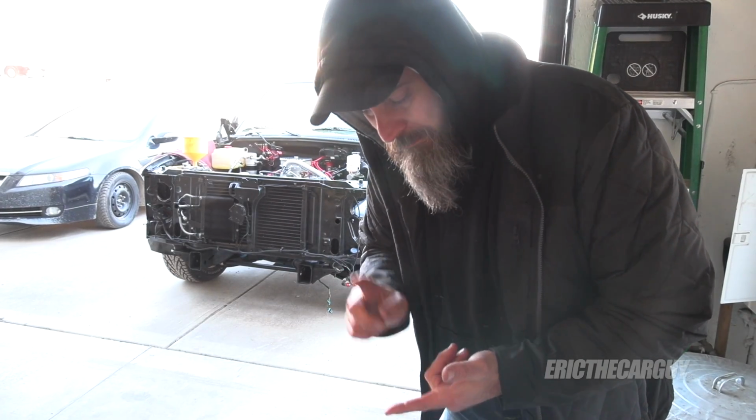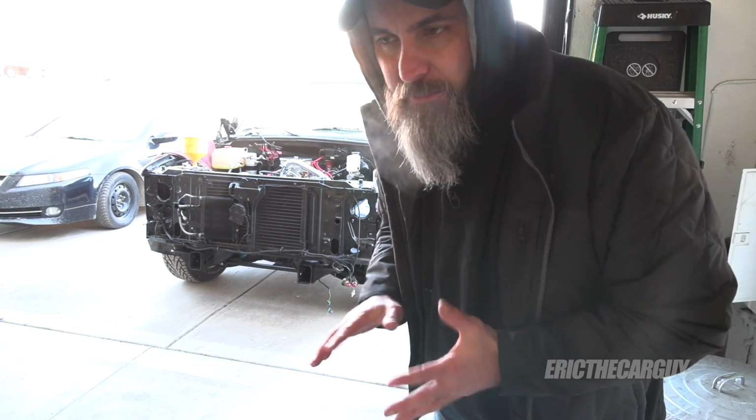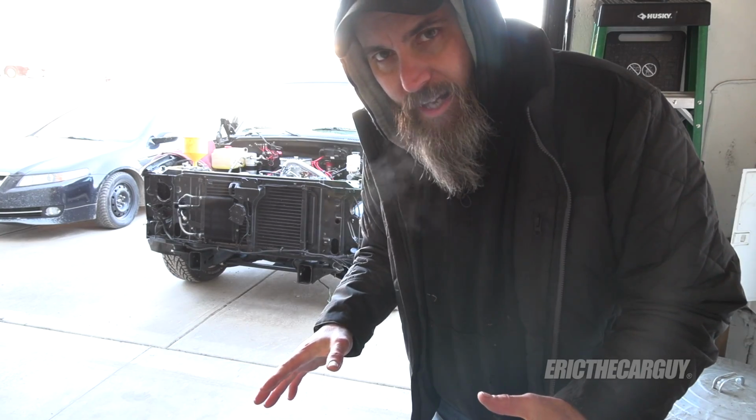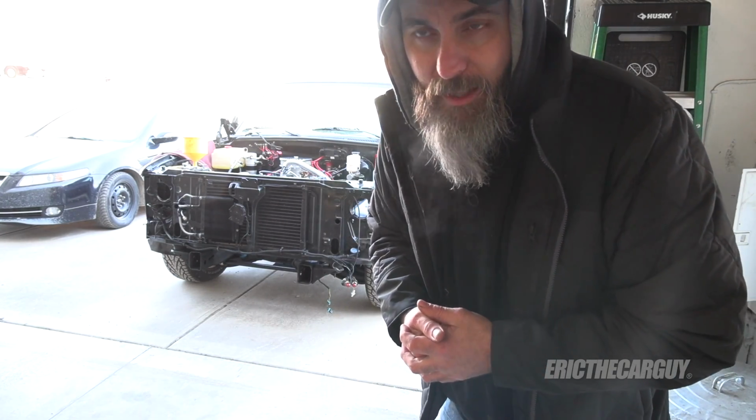All right, base timing is set, basic fuel pressure is set, it seems to be running good and smooth, and there are no leaks underneath. A few exhaust leaks, but I can deal with those in a bit. I'm gonna bring it in, put it back together, and then take it out and break in the rings. I'll GoPro so you can be there with me.